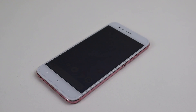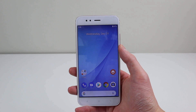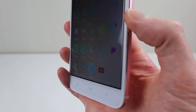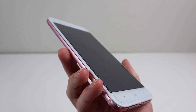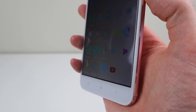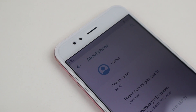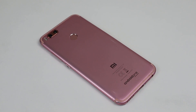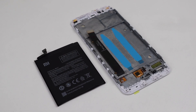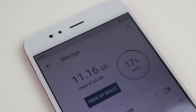And we're done. So this is it — a phone repaired using only AliExpress parts. How did we go? Well, prepare to be disappointed. That new premium display panel looks worse than a flip phone screen from 2005. Front on, the display looks dim and washed out. But view that display from any kind of angle and the screen colours shift and the display fades out. The navigation buttons are unevenly lit, and overall this display is significantly worse than the original one. One strange thing is when the screen is turning off, the colours look perfect for a fraction of a second. In my opinion, I would avoid buying any phone parts from online marketplaces — you're best to stick with legitimate websites and not random, untrustworthy sellers. I love saving electronics from landfill to reduce e-waste, but the majority of replacement parts from places like China turn up like this. I would consider this screen to be manufactured e-waste, as the product is not fit for purpose, it's low quality, and isn't something a consumer would want. Therefore, it would be thrown away for a better replacement display.